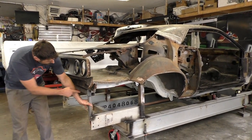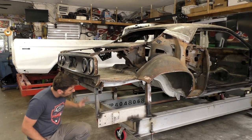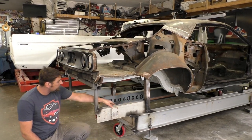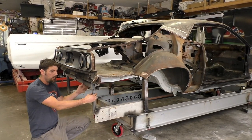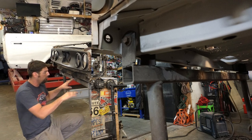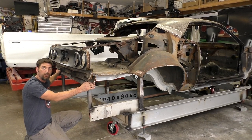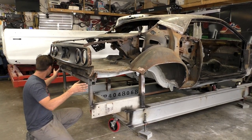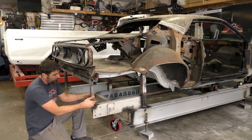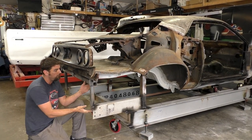You could see what I did down here - I had to make an extension on my frame jig mount. Our frame jig stopped here, so I took scrap pieces left over and extended it out. This is my e-body jig piece that came off the other jig shown earlier in the video with the Challenger on it. We were able to put that on there and modify it for this jig, verifying that the rear frame rails are the right length and distance apart. I didn't want to cut these bars because when I take this back off, it will bolt back into that other e-body jig and fit perfect.